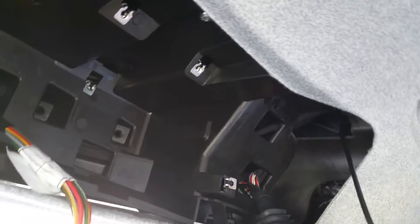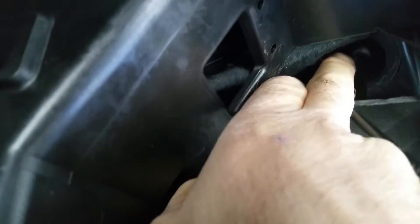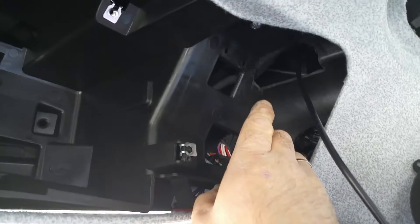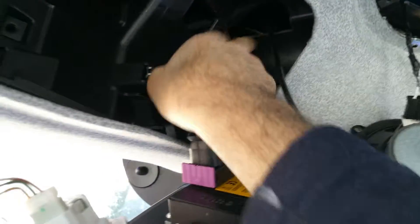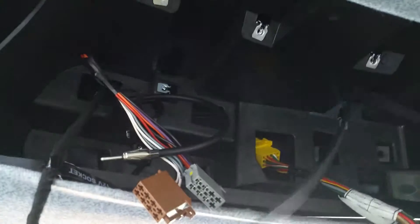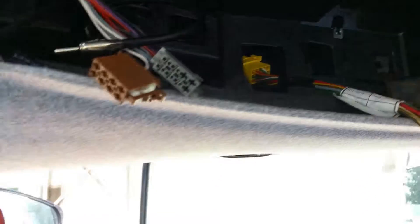The speaker is mounted to that metal wall, so you drill a hole into it. Use a cable harness grommet — you need to poke a tiny hole in the side, then fish your coaxial cable through. You can use an antenna rod to help fish the cable from one side of the metal wall to the other. Once the cable is inside, run it behind and get it to the radio, and put some zip ties to attach it to the harness.